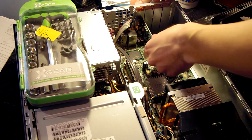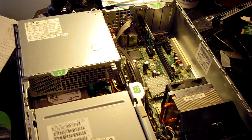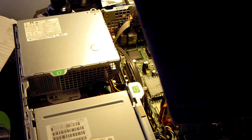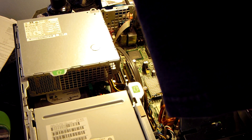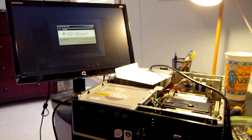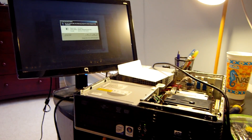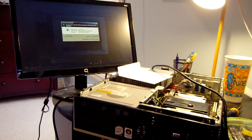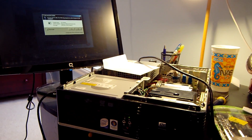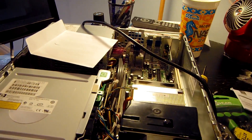That was a very easy upgrade. I'm going to grab the monitor and a power cable and make sure the system will boot with this wireless card installed — I also need to put the antennas on the back. Things are never as easy as you think: when I tested this card a couple weeks ago on Windows 10, it grabbed the drivers and I was up and running within minutes. With Windows 7, that is not the case — the system got stuck at the Windows starting screen. I moved the card to a different PCI slot but that did nothing.